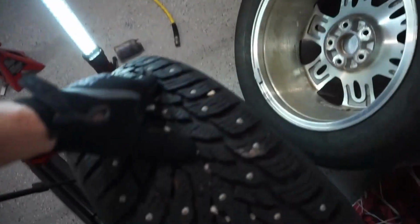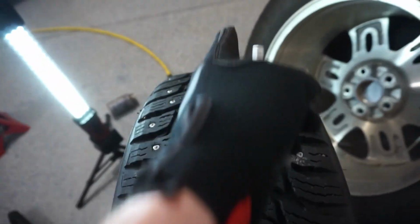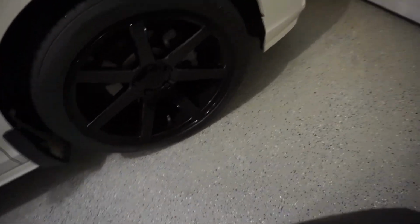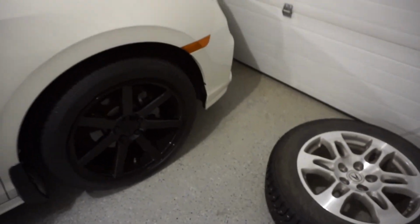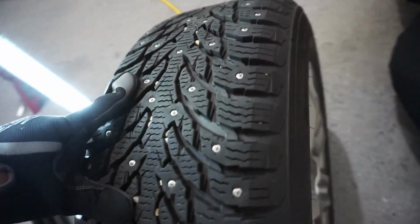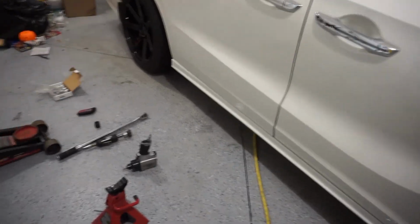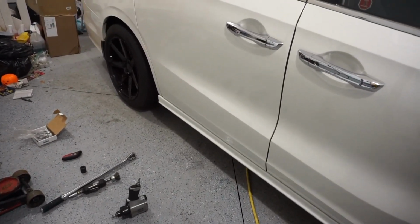So now that I know that this tire is a little bit higher, I'm gonna throw this on the front and I'm gonna make sure that that one goes on the rear. And you notice my direction goes forward like this and the outside of the wheel's like this. So I know that that is gonna go on the passenger side of my car, and this is my front tire, so that is gonna go there. So I'm gonna lay this down beside the front of my car so that I know that that goes there. This, again, facing forward, outside of the wheel, and I know that it had a little bit lower tread, so I'm gonna be putting that on the rear of my car. So I'm gonna go get things lined up and then I'll take you through putting the actual tires on.